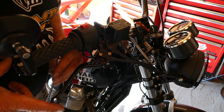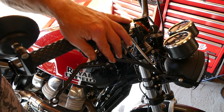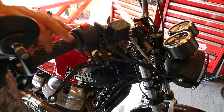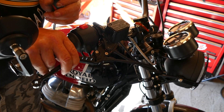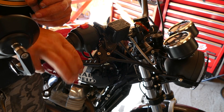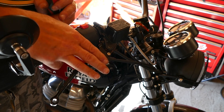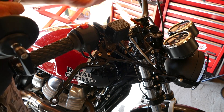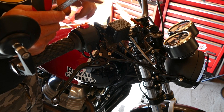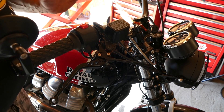If you listen carefully you can hear the click of the micro switch for the brake light, but you can check that electrically as well. You've also got reach adjustment on your brake lever, which is very handy. Never set it so the lever comes too far back toward the bars — if you're two-finger braking you could jam your fingers. Always have reach set so it's well away from the bars. Check both your switches electrically: make sure your clutch switch is operating so you can start in gear with the clutch in, and make sure your brake light is working.